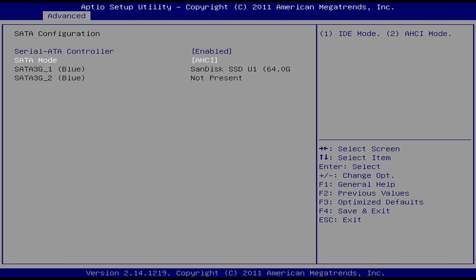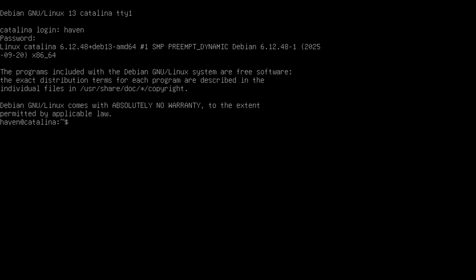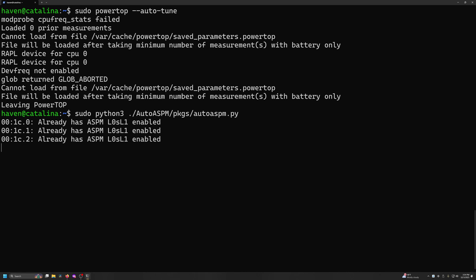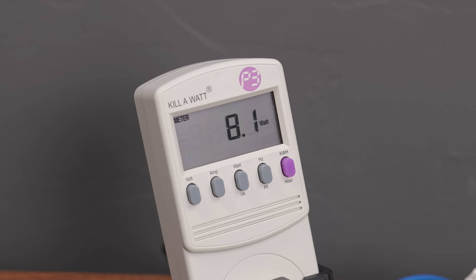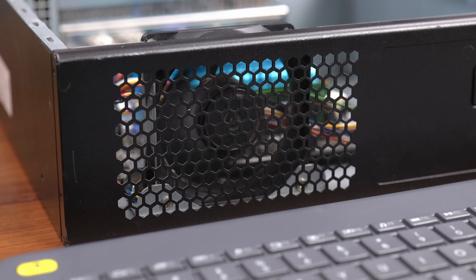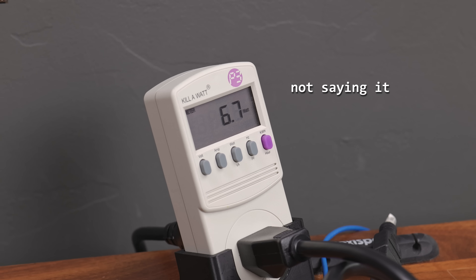I was able to get Debian 13 installed on the mSATA SSD, and as I usually do with systems like this, I tried to see just how little power this thing could consume. I ran PowerTop autotune as well as an auto ASPM script, and after that the system was idling at just around 8 watts. With how little power we were drawing, I didn't imagine we really needed to be blasting that 80mm fan at the front, so I disconnected it, which brought the idle power draw down to below 7 watts.